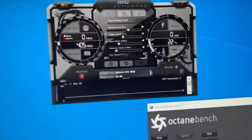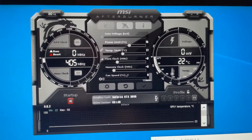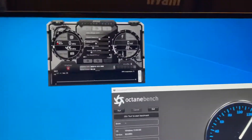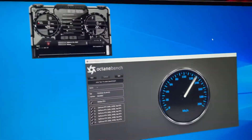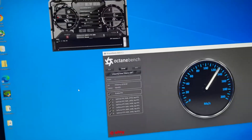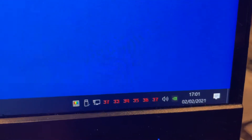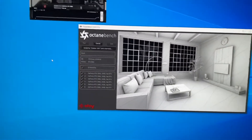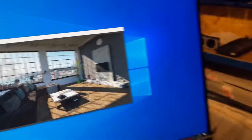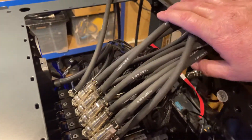As mentioned in the thermal video, we use MSI Afterburner to limit the TDP per GPU. We've knocked this down to 75%; we've tried everything down to 60%, and it does shave off just the tiniest amount of performance. Starting the benchmark now — we can't break somewhere around 50°C to 52°C under 100% load running back-to-back for hours. That tops out on only a couple of the GPUs because they're connected in series.